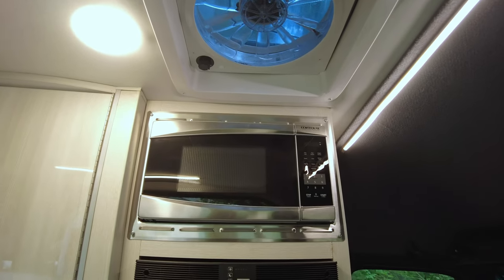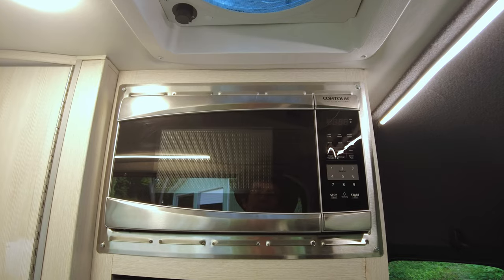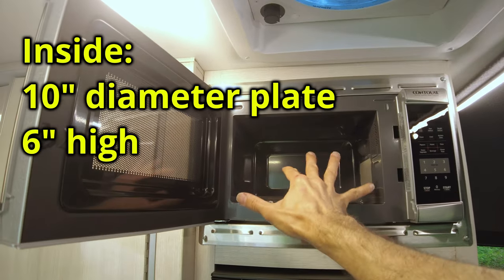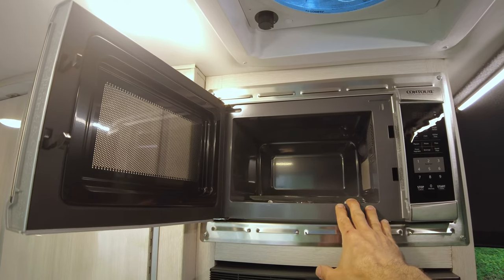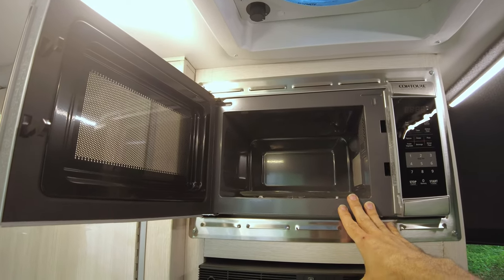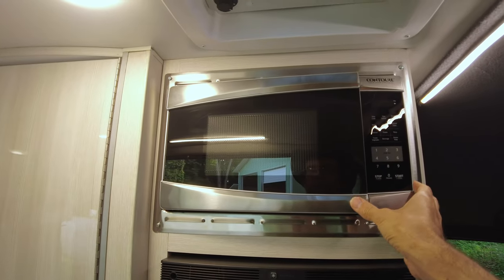Overhead there's an exhaust fan. And then right behind the driver's seat is the microwave and the refrigerator. The microwave is fairly basic. In some of the Thor literature I saw it referred to as a convection microwave, but what we got is just a standard small microwave. It's kind of tiny inside but not crazy tiny and certainly usable. Unfortunately, you can't run this microwave on the inverter. The 200 amp batteries are actually plenty big enough to run a microwave like this for a little while — we've done it many times in our truck camper with the same size batteries but with a 2,000-watt inverter. Unfortunately this has only a 1,000-watt inverter, so the microwave only works when you have the generator on or connected to shore power.